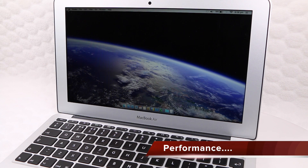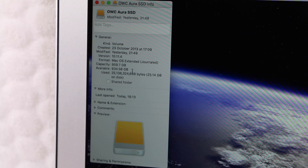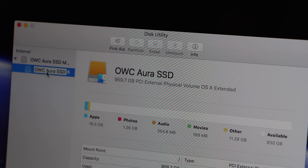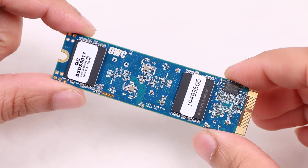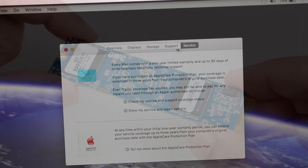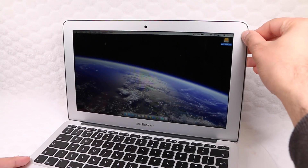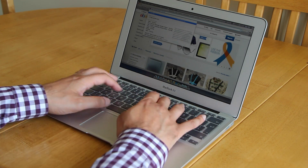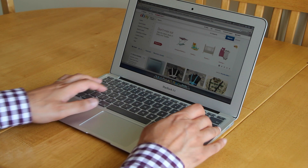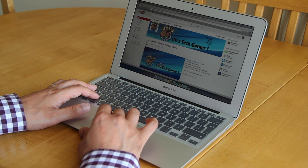As mentioned earlier, there are some points to note. Straight off the bat we can see that the Aura SSD is recognised as an external drive. From a hardware perspective, the 1TB Aura drive is actually two SSD controllers RAIDed together with a Marvell 9230 RAID controller — behind the scenes it's two SSDs, but to the operating system it looks like one big removable disk. Sleep and wake times don't seem notably different, and FileVault encryption works without complaint. The performance is roughly the same as the 128GB SSDs shipped with 2013 and 2014 Macs, so if you're upgrading from one of those, you won't take a huge performance hit — nothing noticeable during day-to-day usage anyway.